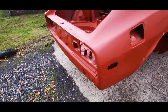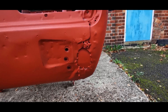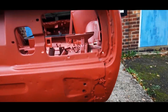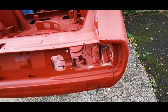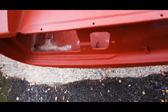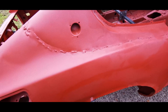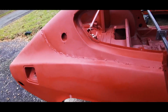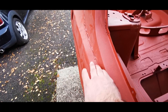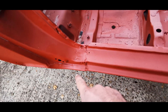Starting at the rear quarter — it's had a rear quarter welded on at some point, and a little patch panel put in there pretty roughly. This one's taken a bit of a beating, and up here we've got a bit of a crack going on. There's rust on the rear boot panel, and then on this side it gets a bit more serious. It's had another rear quarter on, obviously pretty rough, and for whatever reason the angle of this panel does not meet the body — it's probably been laid over the top rather than butt-welded, and that goes all the way down the sill.